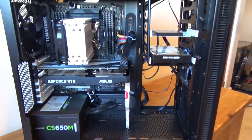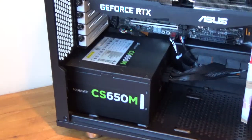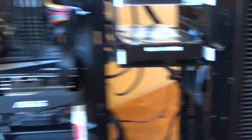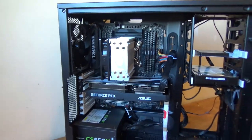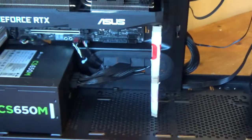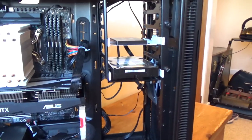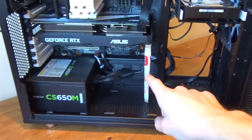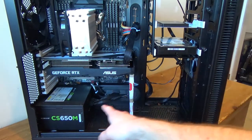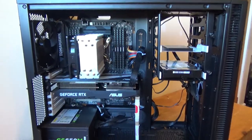Here is my final clean and better cable managed system. I'll start with the power supply as that was the main focus of this video. I have now flipped it over so the fan is on the bottom, balancing out the airflow - I have one intake fan and one exhaust fan so the airflow is balanced and it also gives the case a much cleaner appearance. My graphics card power cable now goes from the power supply up and around behind the motherboard tray, out of that grommet, and plugs in there. The same with my storage SATA power - that cable goes down behind the motherboard tray and plugs in there. Everything goes behind the motherboard tray and is appropriately routed.